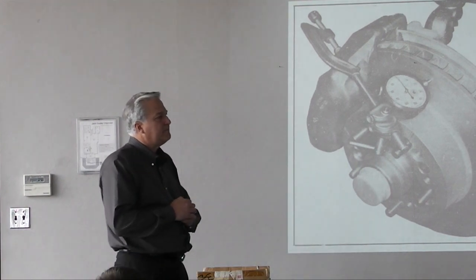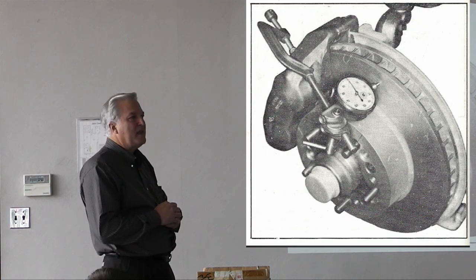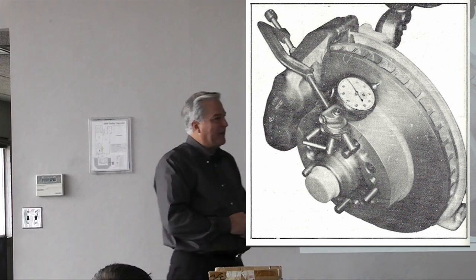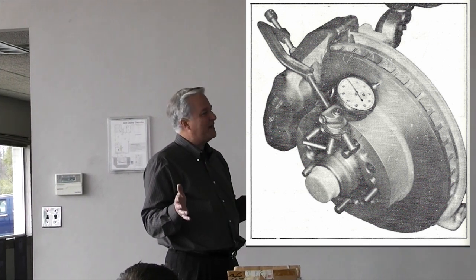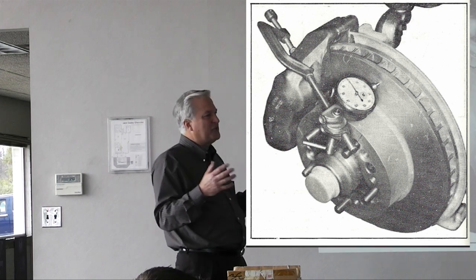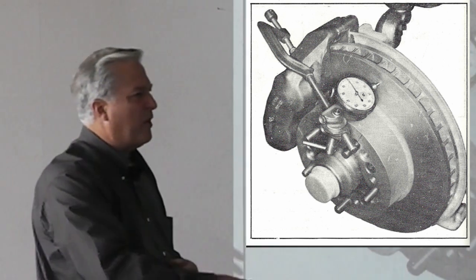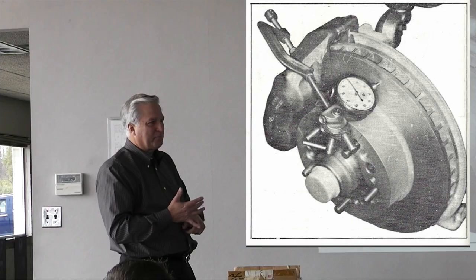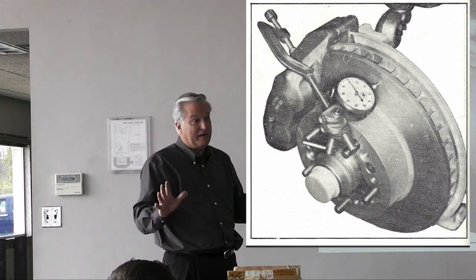Question: What's your opinion of using O-ring design pistons? That solves the problem actually — but O-rings have been around longer than dirt, and I believe the people at Delco Moraine weren't stupid. An O-ring piston will work just fine, but it has no desire to retract. I talked to John Hinckley about it — I was going to write an article about this brake design because I read some hogwash in one of our recent publications touting O-ring calipers. They're no less prone to corrode, and the problem is they won't come back — it'll cost your fuel economy.